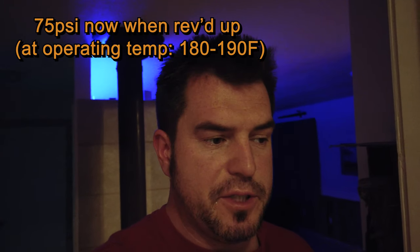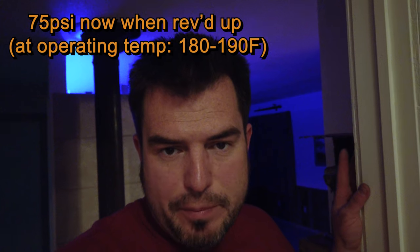Quick update: after making the majority of this video, I changed senders. I had a suspicion that my oil pressure sender was not reading accurately — it was only a 5-bar sender, meaning it only goes up to about 72 pounds, and it wasn't actually reading right, maxing out a little below that in the mid 60s. I bought a UMA sender — a lot more expensive but it goes to 100 pounds. Installed it and the pressure went up quite a bit, like 15 pounds. So I may even pull a shim back out. As expected, this oil pump makes plenty of pressure and my oil pressure is more stable across RPM, temperature, and altitude.